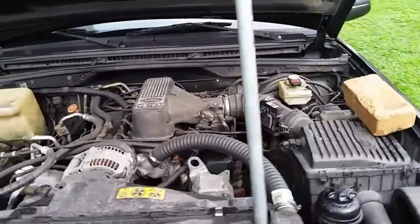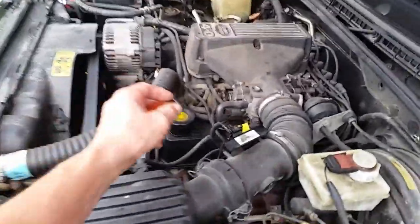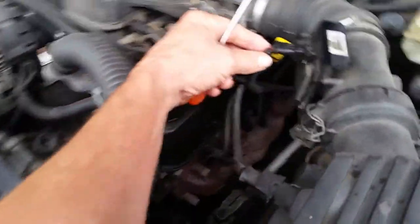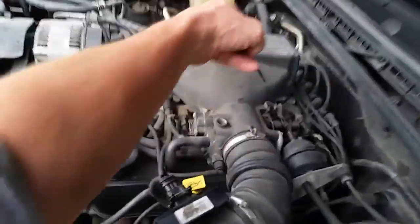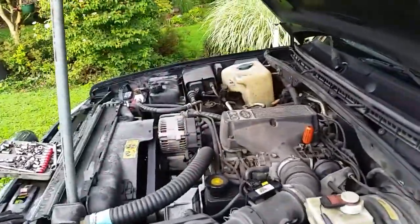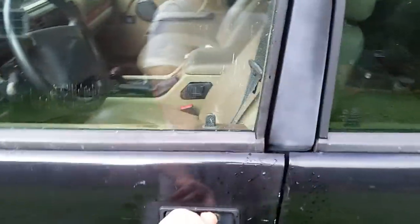So I put some water in it and stuck a battery on it — and would you know, this thing started right up! I may have to stick my screwdriver back in the throttle to make it idle a little bit better; it does have an idle issue. I hooked the mass airflow sensor back up — someone broke it off. So we'll go ahead and crank this up. I found out a few things: there is a leak, but nothing major, and the engine is pretty warm.